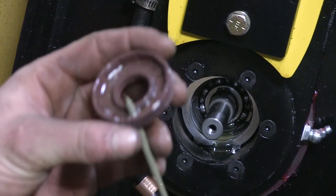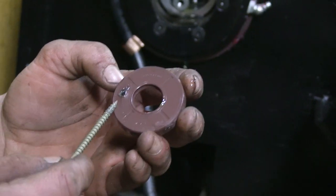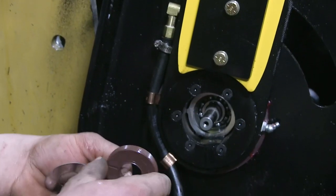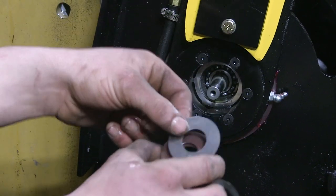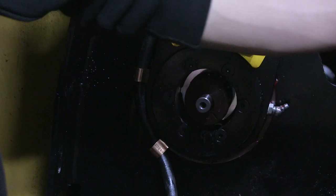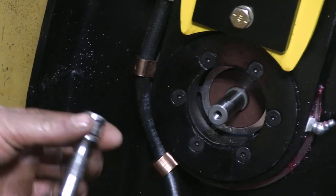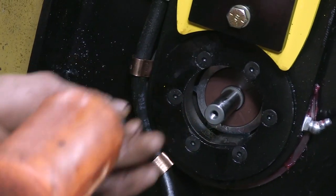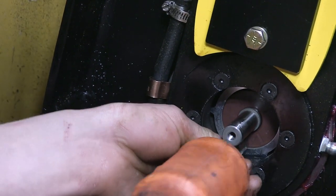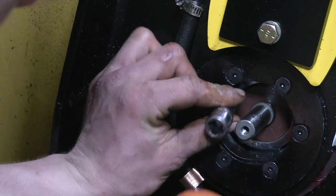As you can see, they're pretty tight. That's what your seal will look like, and if it's blown it will be all bulged out and maybe have a rip or something. You'll take your new seal, put that in first, and put your shim in front of that. But first you've got to make sure the seal is in there and seated good, pressed in all the way. Take a rubber mallet and work your way around, giving it some light taps to make sure that seal is in there all the way. Don't want to dent it up — just lightly get it pressed in.